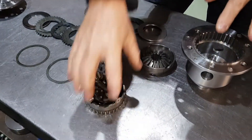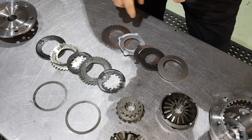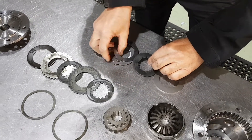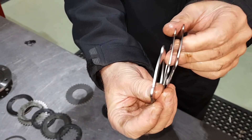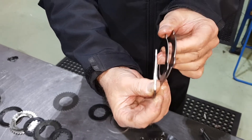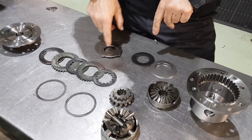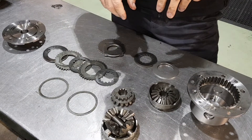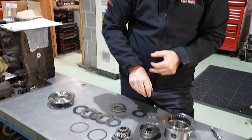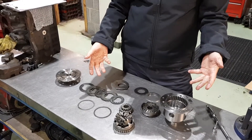The other option, which is what we're doing to this one, is changing the plate pack. The spring compresses all of these plates, and if you put a different thickness plate in, you take the tension off the Belleville washer. There are two different thicknesses: two on the left are 1.5mm, one on the right is 2.5mm. With those in, this would be 65 foot-pound torque preset. What we're going to do is put slightly thicker ones in for the customer, which will bring it up to 90–95. So you can tweak the setup in two different ways — different ramp blocks, different configurations and thicknesses of clutch plates.